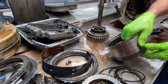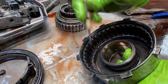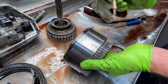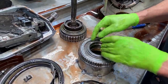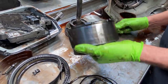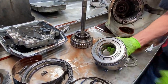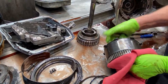What we need to do is go over this drum and see if it's destroyed. If it looks good, we come in and scotch-brite all this area where the seal runs, scotch-brite this inner part too where the seal runs. Then come in with 180 grit on the drum all the way around, put a new sprag in here. New bushings top and bottom, but you really want to look in here for any type of seal wear.